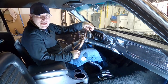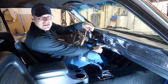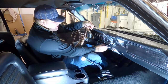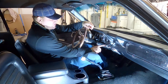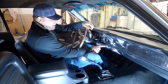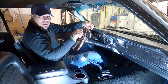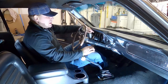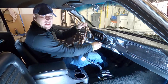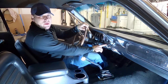Hi, my name is Andy and on today's video we're going to replace the ignition switch on my 1966 Mustang. The problems I'm having are: the bezel is sticking out, which suggests it's been replaced before, the key doesn't fit very well, and when the key is in there I have to wiggle it just a little bit because none of the dash gauges or lights work unless I do. So it's time to replace the switch.